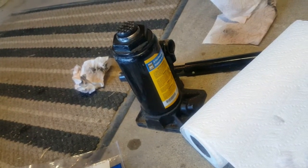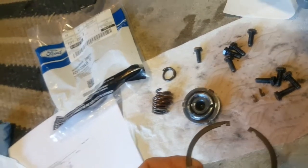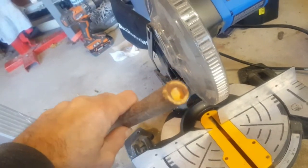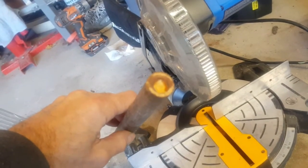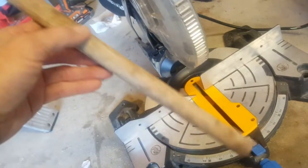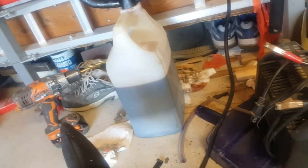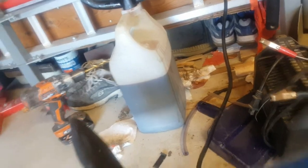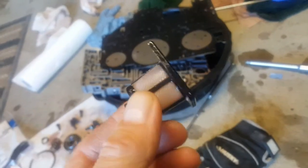I need to wait another day for that spring. I found a wood dowel to go on top of the jack to push up the overdrive piston so I can pull out the old snap ring and put the new one in. I drilled a little hole at the top to fit over the nut on the piston. Here's how much fluid came out in the pan. Also, the screen at the bottom of the pan when I drained it - apparently you can throw that out.